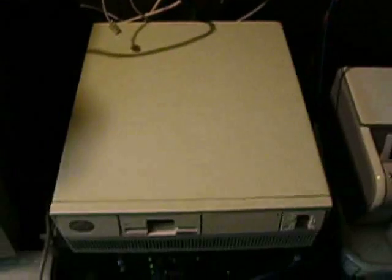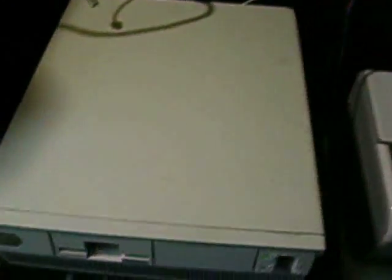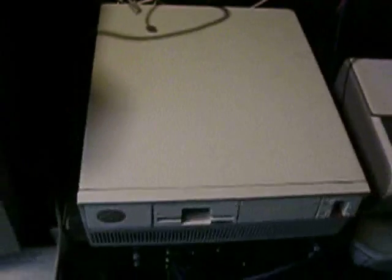There are lots of ways to bridge between dissimilar types of networks, but nothing beats the old-time charm of using an old computer, such as this PS2 Model 50, that otherwise might not receive a whole lot of use. The IBM LAN bridge program does not require much in the way of hardware — it needs DOS 3.3 or higher and about 640 kilobytes of memory, both of which this system has.